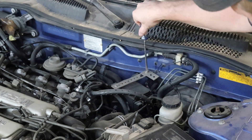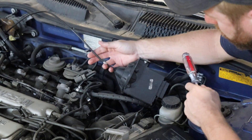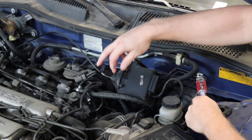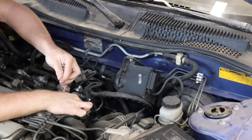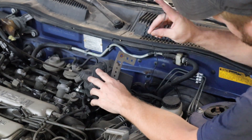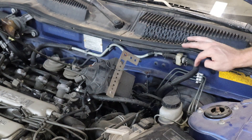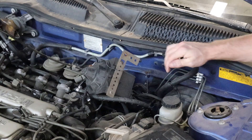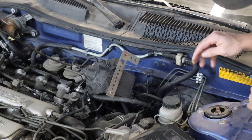It looks like a pretty simple bracket holding it in. We have a throttle cable attachment going to where the other throttle cable attaches, so I'm going to see how that's rigged up and try to get that out of there. There's an electrical harness going through the firewall — that's probably going to go to that switch. We've got a ground here, and there is a T off of the brake booster, which we've got to remember to either replace with a vacuum connector straight through or cap off, because we don't want to leave that open. That would be a pretty bad vacuum leak — probably one of the worst places you can have one.